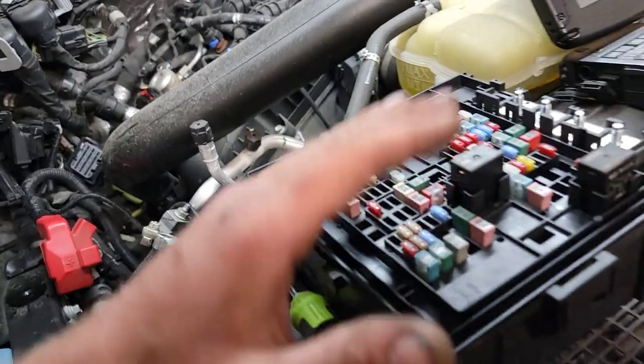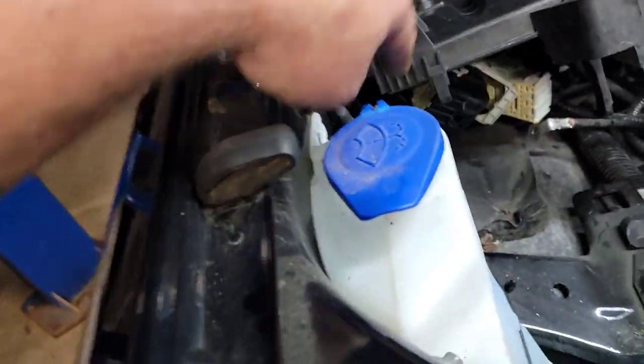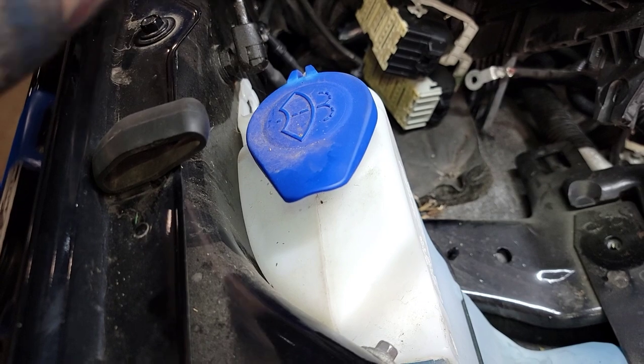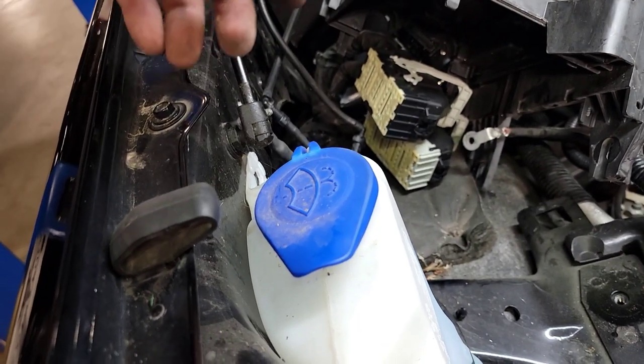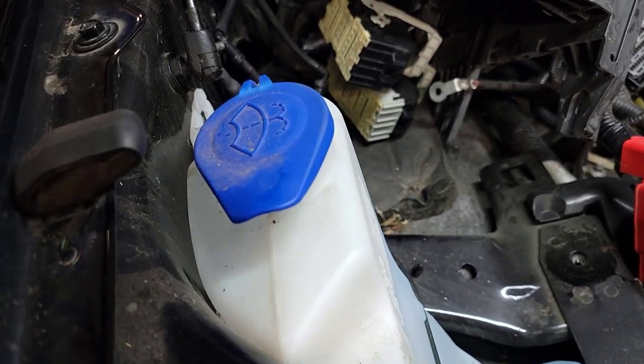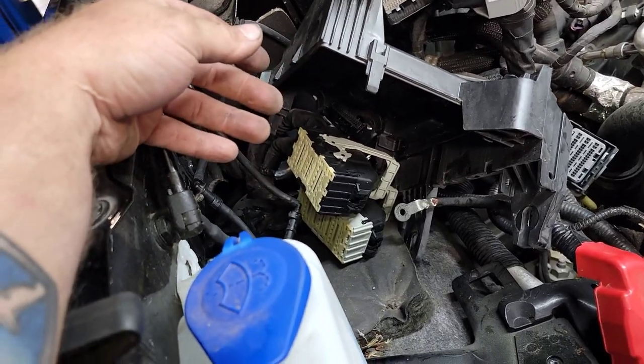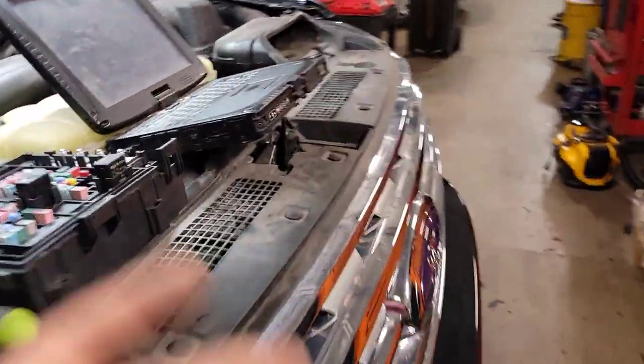I got this out. This is the front part of the box where you can easily release the tabs on the side. But in the back you've got to pull the two 10-mils out, slip the side track off, flip the box kind of upside down and wiggle the connectors. That's the bottom of it disconnected. It's not as clean cut and dry as they make it seem — especially with that gray connector going to the connector clipped into the bottom of the box that they don't say anything about.